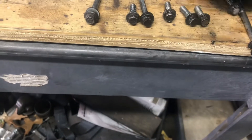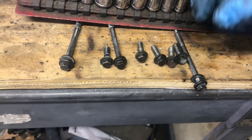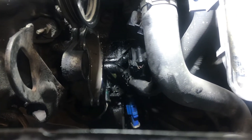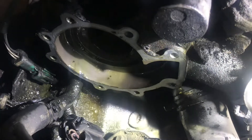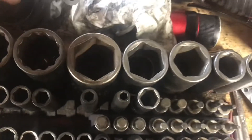In case you're wondering what your bolts look like in order — starting in the center and going clockwise you get a long, a short, a long, then four more shorts. Once you've got the pump out, get this surface area where the new pump is going to go cleaned up real nice. Once our new pump gets here, we'll start getting it installed.